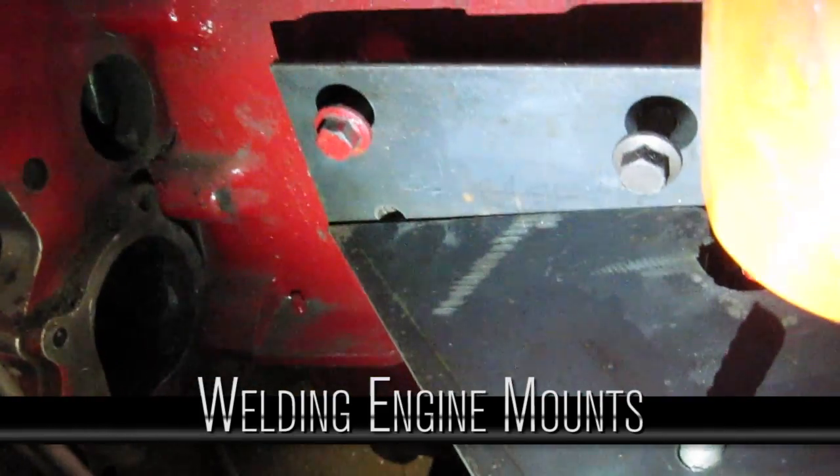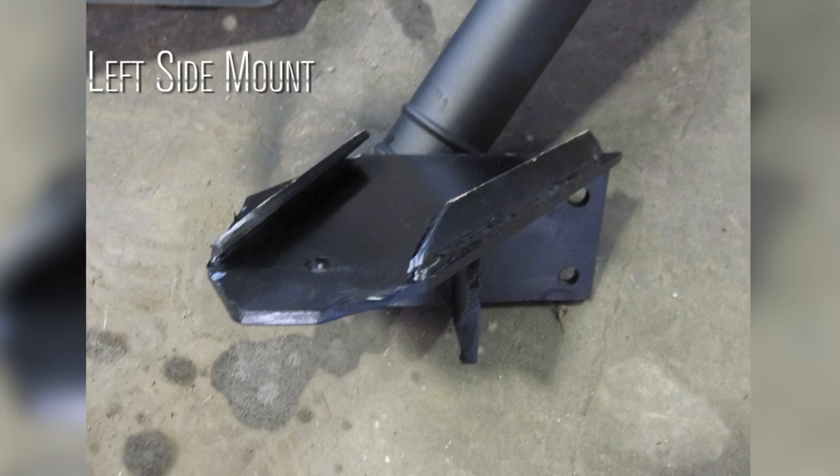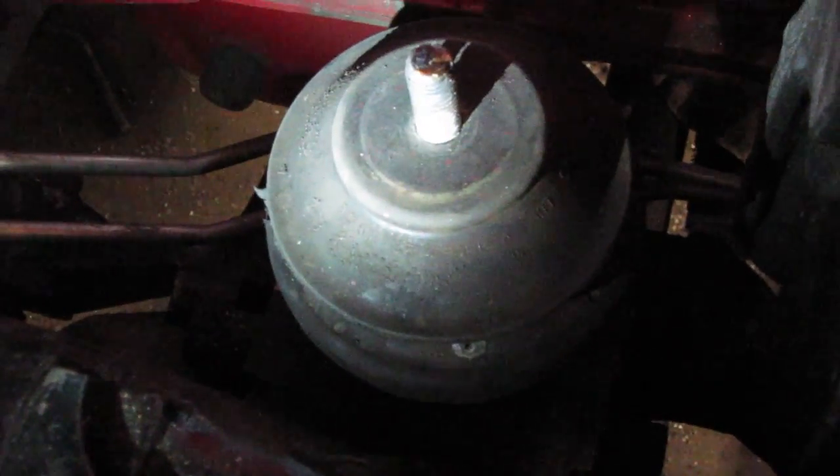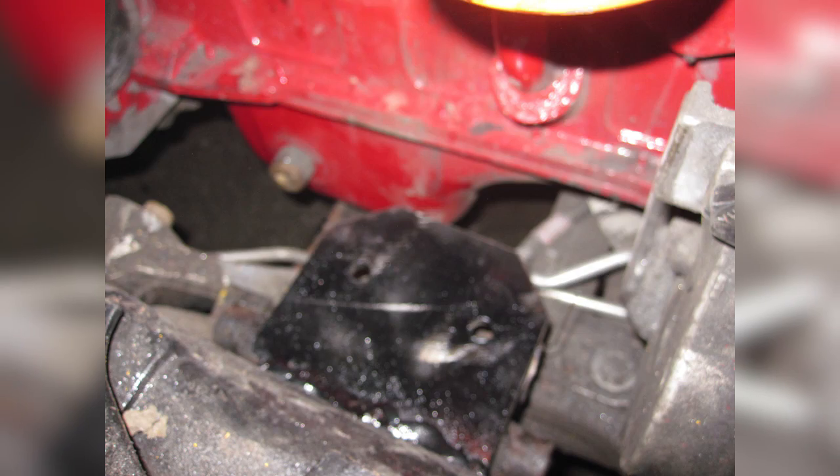This is the engine mount on the right-hand side — just marked it up first. Put the bolts in and drill a plate attached to the engine, then this plate will sit right on top of the gel mount, notched around the turbo drain tube. The mount just sits on a plate with two little notches to sit tight against the frame. I cut that outside tube out that the original 5.3-litre mount sat on and I'm going to weld it right to that bracket — that should hold her.